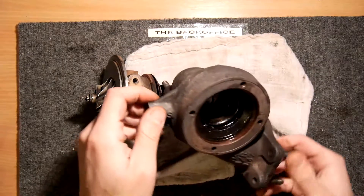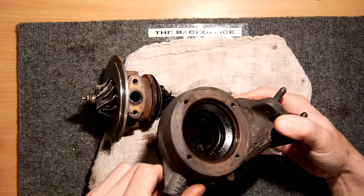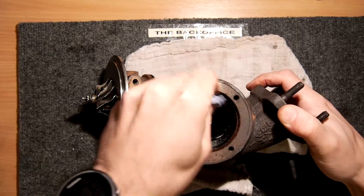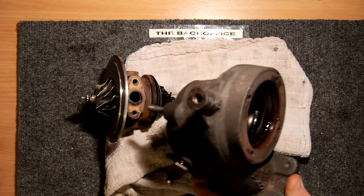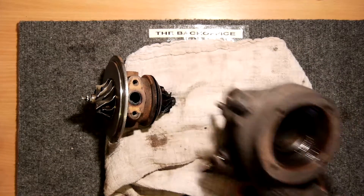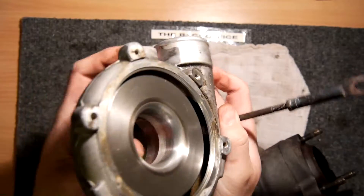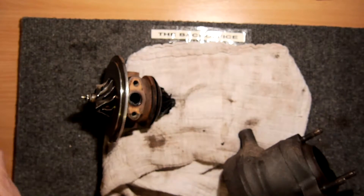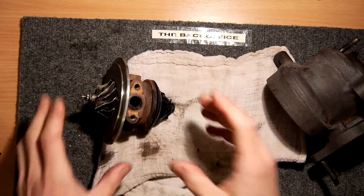It took a bit more bashing than I would have expected, frankly. But this part looks great — there's no real damage here. I'm just checking for scoring in here; there isn't any. If it's scored we're going to have problems, because if we fit a new cartridge the performance will be impaired. So this is the exhaust side, made of steel or iron — something heavy. The intake side is nice and lightweight aluminium. Checking for scoring again — I think it's fine. Whatever's gone on has been very light, because they must be making these impellers out of something very soft to ensure that if the impeller gets sucked into your engine due to damage, it's not going to break your engine.